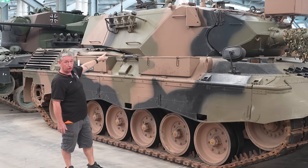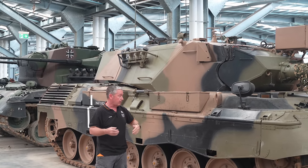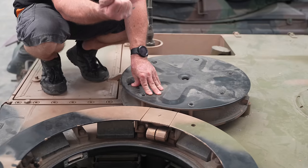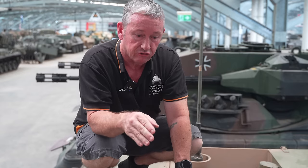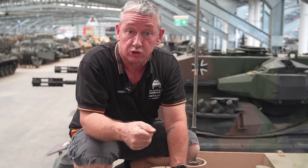We put a tower on the crew commander's position and from there that's where all the air is drawn in to run our engine. The commander's hatch has a very unique safety mechanism: if we're going through water there's a micro-switch. It prevents us from closing the commander's hatch because we need to have air coming through, so it actually switches off the engine.